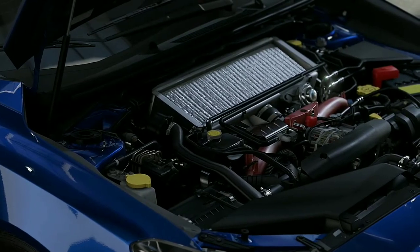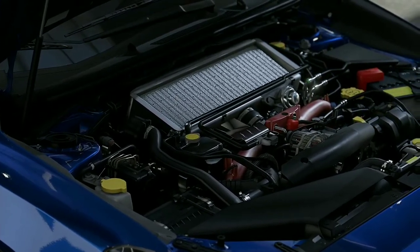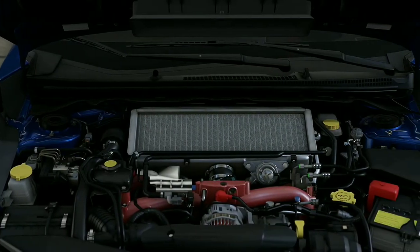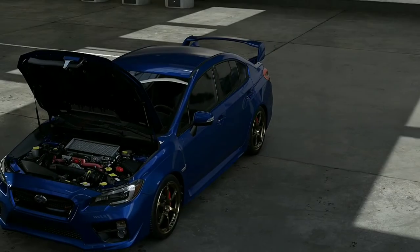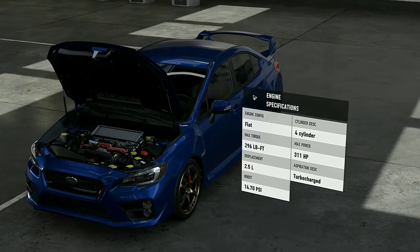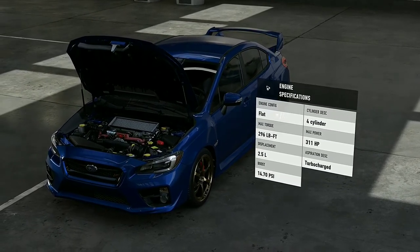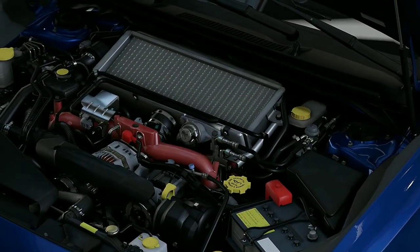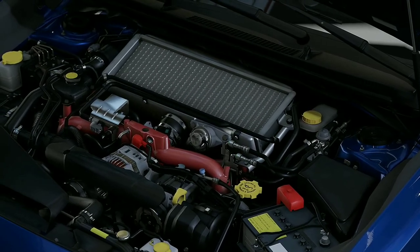Alright, I really hope that gave a good idea of how the DCCD works. So like I said, that first one was our regular torque split, that second one was our auto minus which had roughly the 70/30 torque split, and then that last one was our auto plus torque split. I hope that showcased it pretty well — if not I apologize and I'll try to remake this video. But now I'm gonna move on to the VDC for you guys.